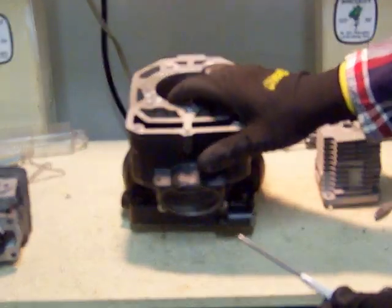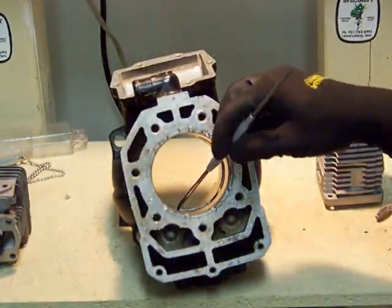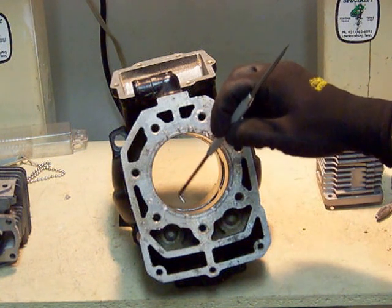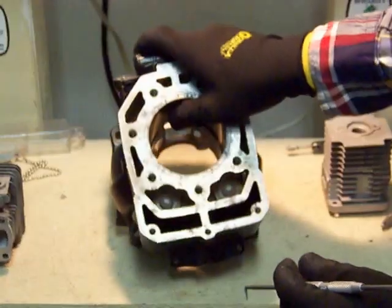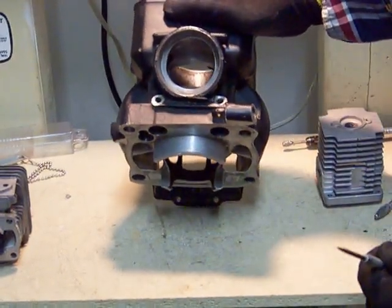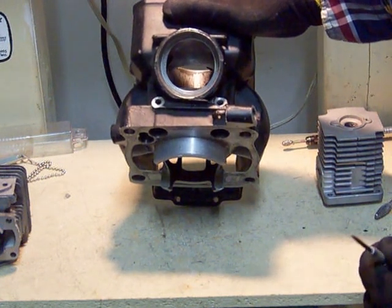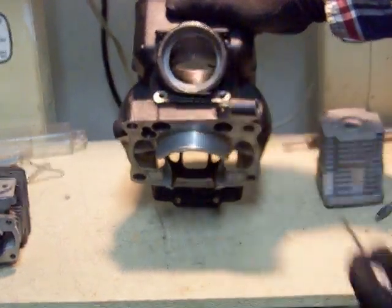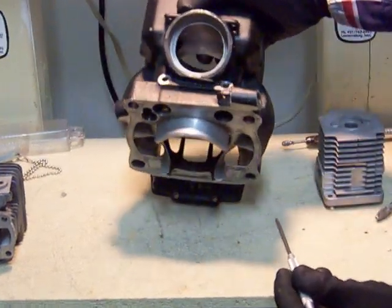So where the upper roof is determines your timing. If you move it down so it doesn't open until 100 degrees of rotation, that puts your RPM timing closer to 9,000 RPM. I wish I could get into all the complexity of that, but you can find the formula explained in detail online at ccspecialtytools.com in my Tips and Techniques section under TJ's Two-Stroke Tips. It explains the exhaust work in depth — I just don't have time in this format.